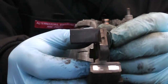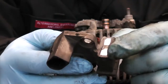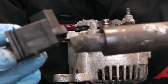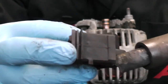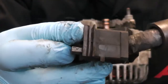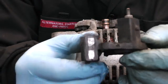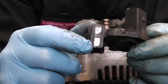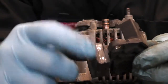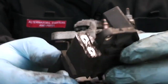The tops are off and these surfaces are quite shiny. What we do now is just heat it up with the soldering iron and the brushes will simply hop out. If you're going to be doing it yourself, it'll be a bit easier if you just put a bubble of solder on first. See — one brush is out, and now we just heat up the other one and the other one is out. What you also want to do is give those surfaces another shot of iron and make sure you have a visible hole in there, so you can pull the new lead from the brush out through them.